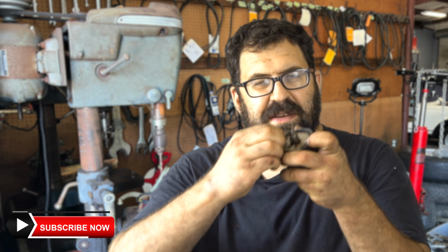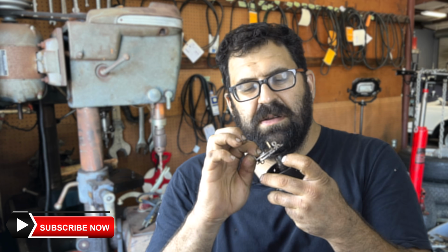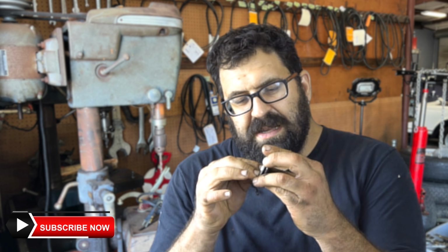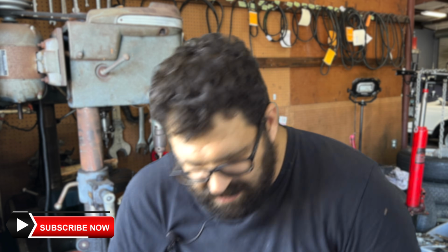But if you have a distributor in your Mercedes or your Bosch distributor, like a Volkswagen or Porsche or whatever, and you have a set of points, those points ride on a breaker plate. I've actually moved this out of the distributor a little bit, but that breaker plate lives inside the distributor so that the points can rest on it. And what the breaker plate does is where the points attach, I'm going to try to set this up properly.